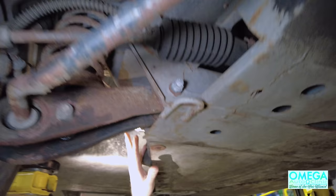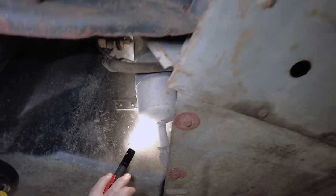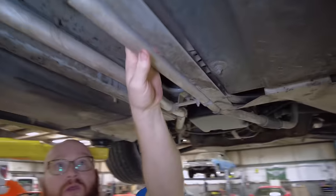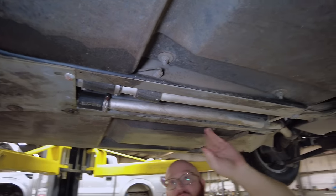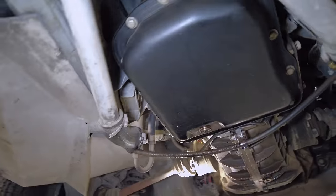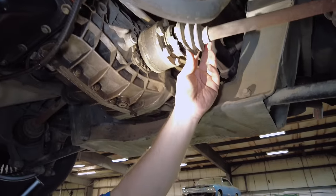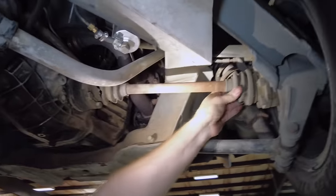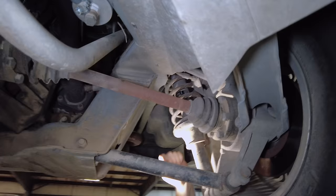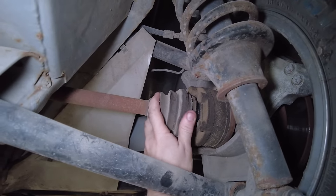We can see some of our air conditioner parts here — this is underneath the frunk. You can see fuel lines and the fuel tank, things that are all up in that area. As we come back here, you can see coolant radiator pipes going to the radiator and back to the engine, just like a Lotus. Here's our automatic transmission on the back of this PRV — it's a transaxle, actually. This one's kind of leaky; it's one of the issues the customer wants addressed. Here are some torn CV boots — there's one on this side, this one's torn, this one's okay. You can see it has a new fuel filter. Brakes look good, strut is dry. The outer boots on the CV shafts are not torn, but the clamps are a little loose from age — those need to be tightened up. If we're going to pull these off, we might as well put all four new boots.